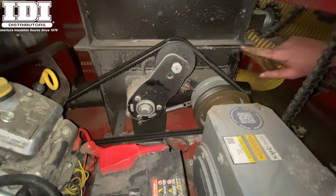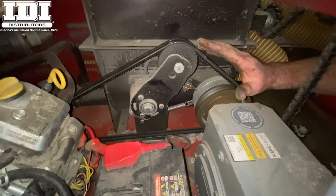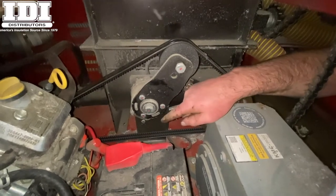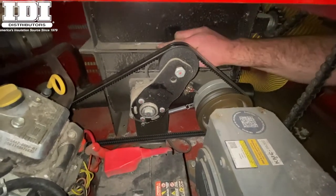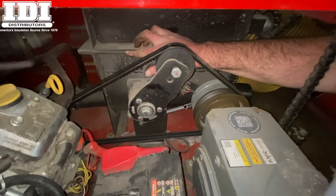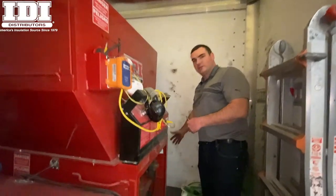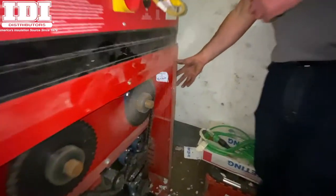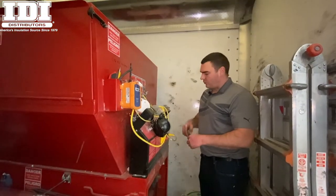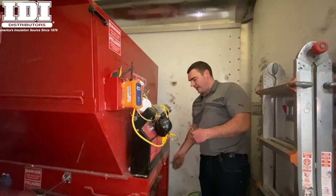If you look, we have a small gap here but over here it's still pretty tight. The reason is when we slide this airlock in, there are ramps in the back that lift the airlock up to make the seal, so we can't lower that side down — that's where it's really tight right now. When you install your machine, it's good to leave some space in the back for maintenance access. This airlock was in there pretty tight, so we're going to go to the back, remove the back panel, and get down to that hose so we can take it off.